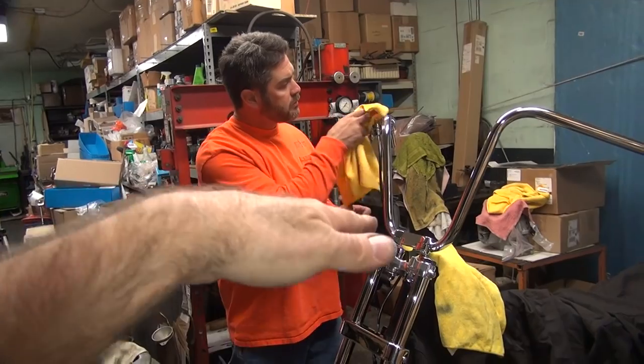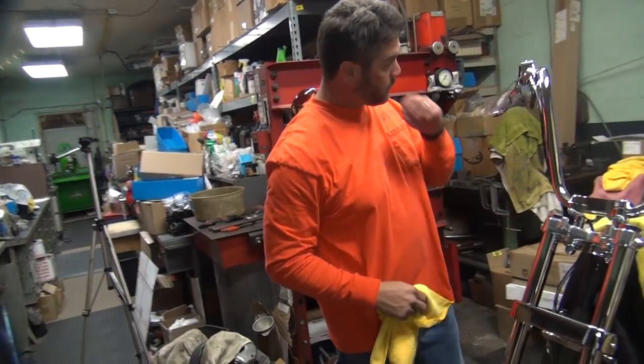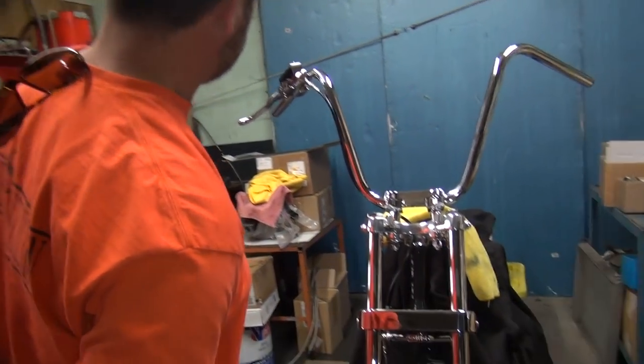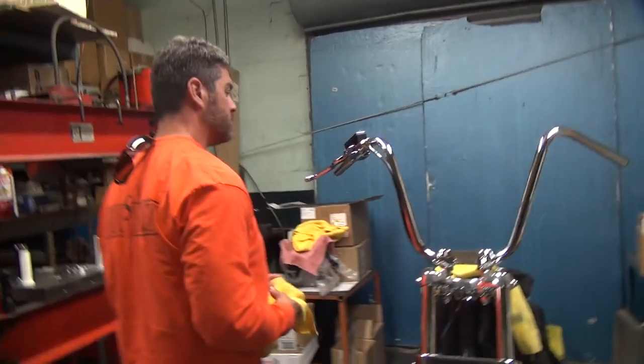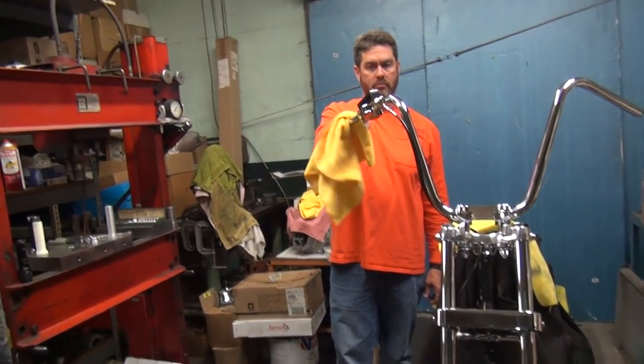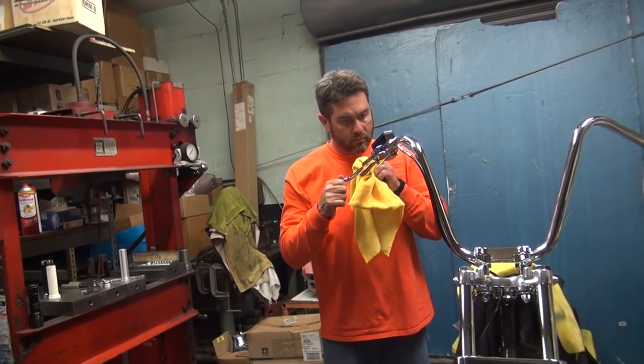We are going to have to get the master cylinder back out, angled up to get the air out of it again, because right now it's going to collect right at that banjo right there. You can always crack the banjo to bleed air, but it just makes a mess. It's just like bleeding a brake caliper. But yeah, it looks pretty good there. Lines up. It's not leaking out of the backside yet, so the rebuild was holding. O-rings are holding.